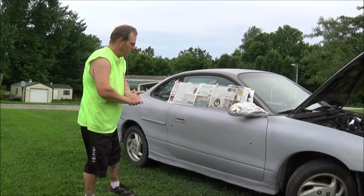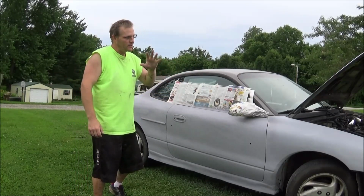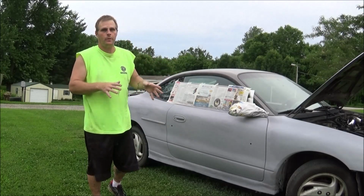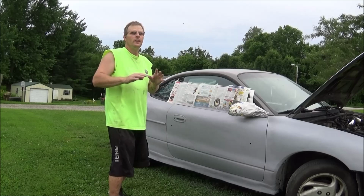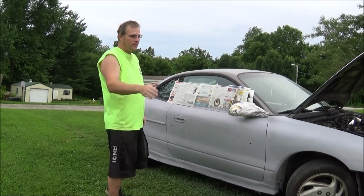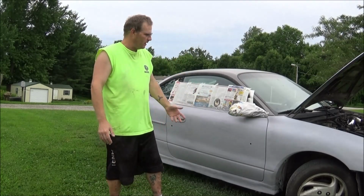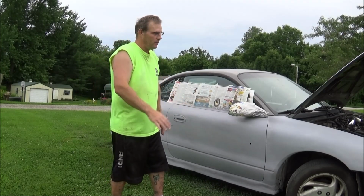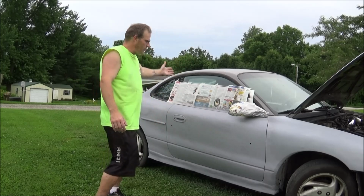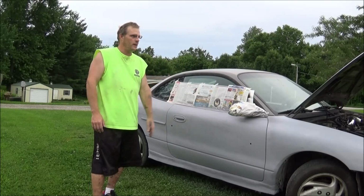Oh boy, feels good to actually accomplish something. I got the rear quarter yesterday. I had started on the bumper yesterday. I finally got the bumper to a point where now all it is is fine tuning, and then straightening up the edges and stuff, and then a little bit of spot filler, some hand sanding and stuff for finishing everything off, blocking, things like that. So anyways, yay, I got that much done, and that much done.